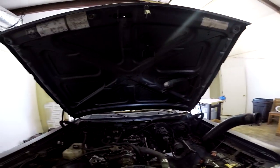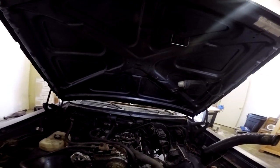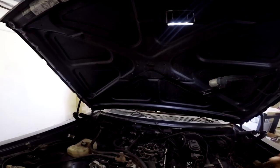It's an intro to everything. When you get to the fuel injection systems and EFI, they're completely different than this. This is more pertaining to CARB and the actual TBI, not EFI systems, because you got a bunch of other sensors and stuff you're going to have to worry about.